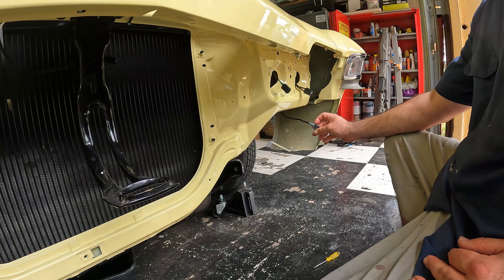We ran it from here, which is going to hang somewhere around the grill, and then we jumped it to the corner lights. We deleted the fender corner lights, so basically this is going to run as a parking lamp — not a turn signal — on both sides. This kit had two brown wires for the same parking lamp. Usually you jump them all across, but this one had a left and a right. So brown coming out the firewall jumps to here, another brown coming out the firewall all the way over to the other side and then jumps to the light.